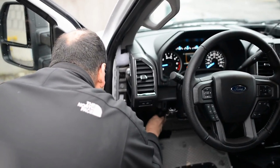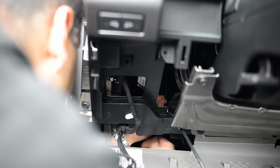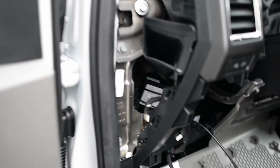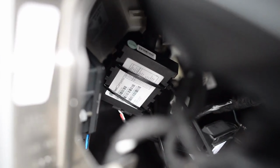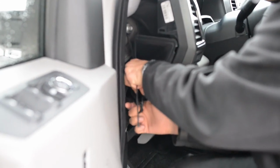Install the modem. Avoid breakage or poor data transmission by securing the device to a steady part or panel beneath the steering wheel. To avoid excessive loose cables, bind the cables with the zip ties and store them in the panel above the gauge cluster.